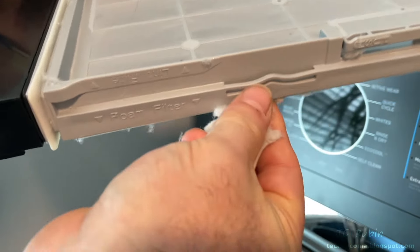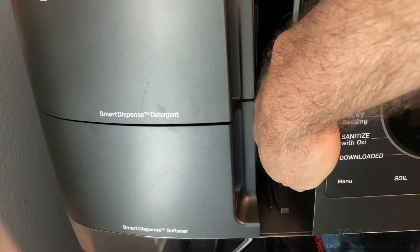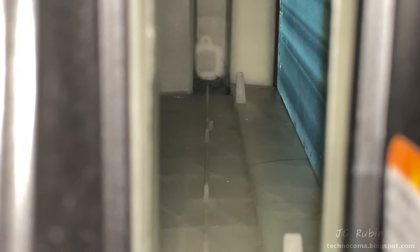We felt that things were getting through the filter — not a lot, but it seemed like over time these little pieces of lint making it through to the heat pump were going to start building up. Eventually this was going to become problematic and reduce efficiency until sensors started tripping and repairs needed to be made.